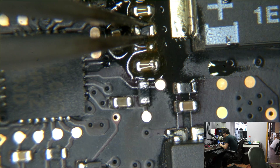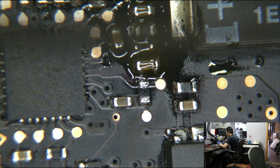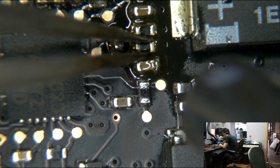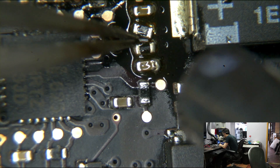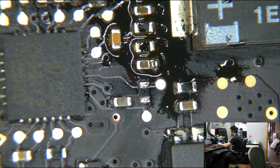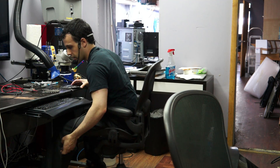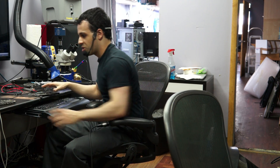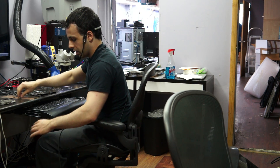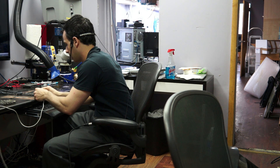Current sensing has a lot of good uses. This is on the charger side, which is a little different. But on the battery side — you know when your computer says you have four hours left on the battery, and then you open a video editor, a video game, a high-definition movie, or run Prime 95, and suddenly it says you have 30 minutes left? How does the computer know that just because you're doing something intensive, you have less battery life? The current sensing circuitry is sensing how much amperage the computer is using. If it senses you're using more amperage than before, it knows you're going to have less time. So the time calculation is actually based on the current sensing circuit. It's also there for safety — if it thinks it's drawing 10 amps from a charger supposed to deliver 5 amps, it's going to turn the charger off to protect the machine. Same from the battery — if there's any fault condition, it turns itself off so you don't burn yourself and end up suing Apple when things go really bad.